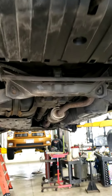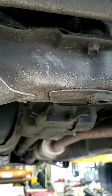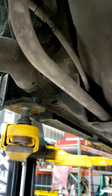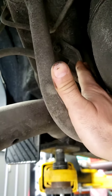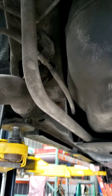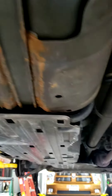I'm going to show you the underneath of this. This is a 2013 with low miles, which is usually worst-case scenario for a vehicle. We're working on other ones where the rear control arm is rotted right off and breaking out of the vehicle because it rots from the inside. Luckily, when we rust proof, we fog the inside of the frame rails as much as the outside — we actually use more product on the inside than the outside.